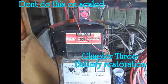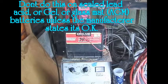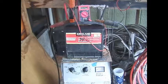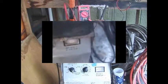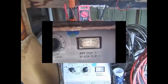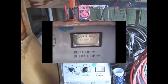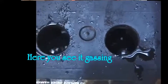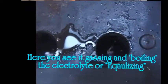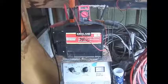Chapter 3: Battery Restoration. A car alternator cannot restore a battery to full capacity because it cannot reverse sulfation, as its maximum voltage is usually 13.5 to 14.5 volts — not enough to reach a state of equalization, which is around 16 volts on a 12 volt battery. Charging a battery up will not restore its capacity unless it includes equalization charging. So a trickle charger, a 2 amp charger, or any charger that will not get the battery to 16 volts will have little effect on hard sulfation and will not restore the battery's capacity.